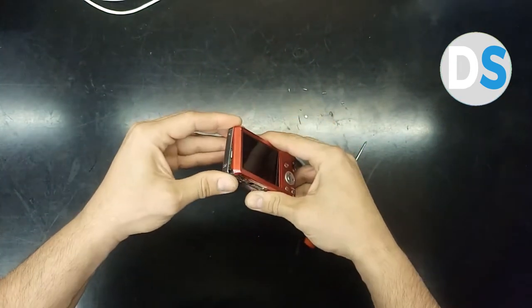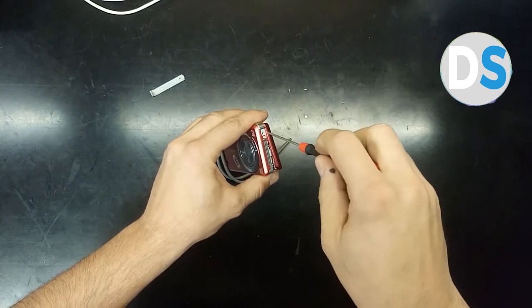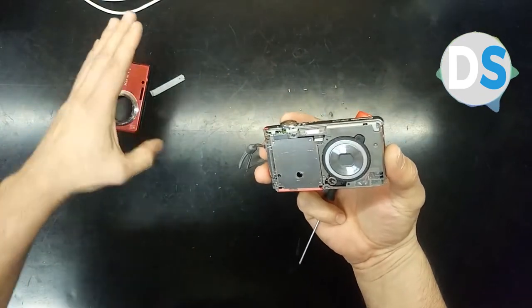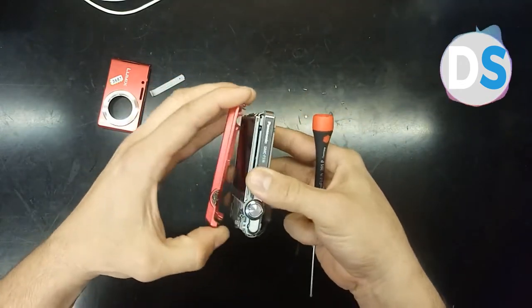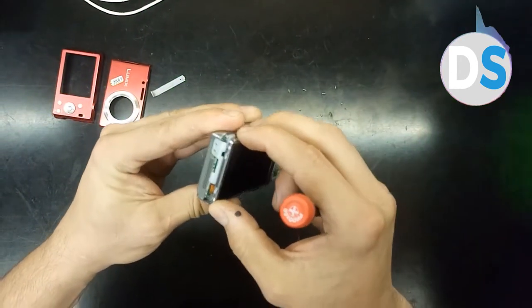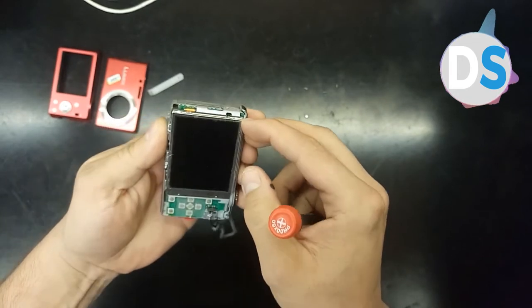It's not known on the Bulgarian market, but anyway, the customer complained that there are strange objects in the final pictures, which, after checking at the service, there is no other explanation except that there is some dust inside the lens and most likely on the surface of the CMOS sensor.